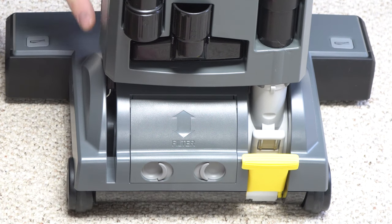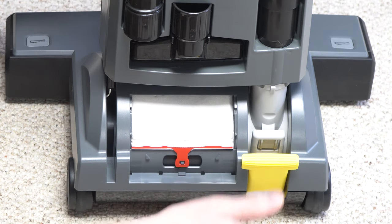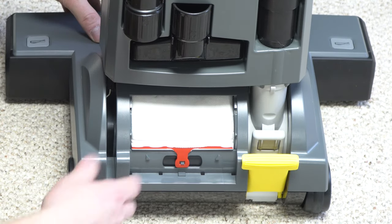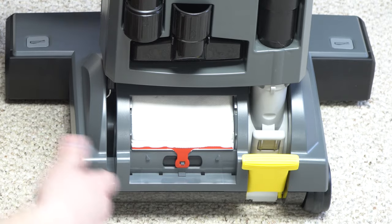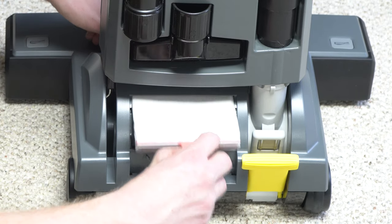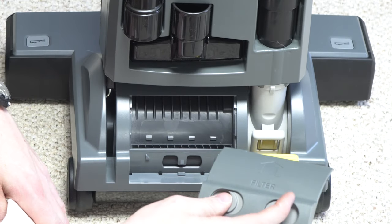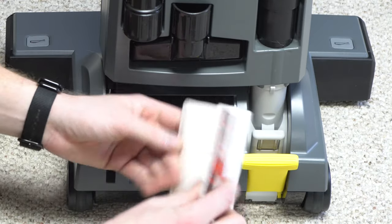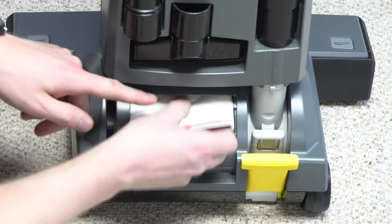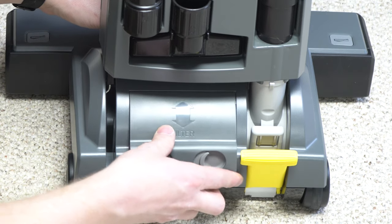One of the biggest upgrades to this generation is the filtration. Previous generation machines relied on the top cover to hold the filter in place, and sometimes maids would crack the top cover and the filter wouldn't work right. Even if that happens on this machine, the filter goes directly onto the motor, which is independent of the top cover. The filter cover in the back means you're not going to damage it — it looks like a little mini vacuum bag, and it's really easy to change. It just snaps on, and this cover feels very nice.